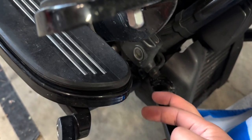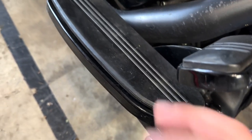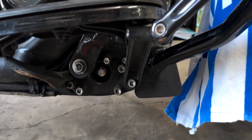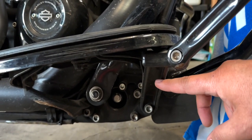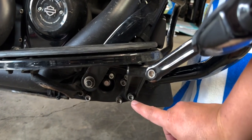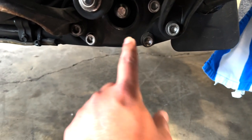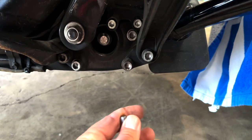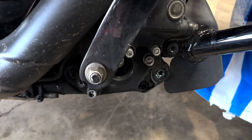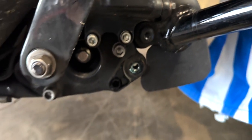I'm not going to be able to get to that without taking off my footrest, and I'm definitely not going to be able to torque it down without removing it. I have the Zero frame-mounted highway pegs, which replace the standard piece with a solid piece so it's not attached to your engine guard. We're going to take this out to get to that bolt. All three of these are 5/16 Allen — take those off and the platform comes off, giving you easy access to that Torx bolt.